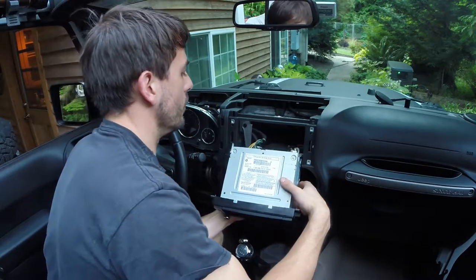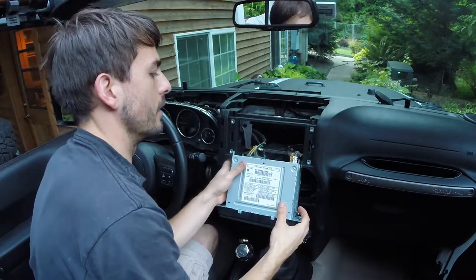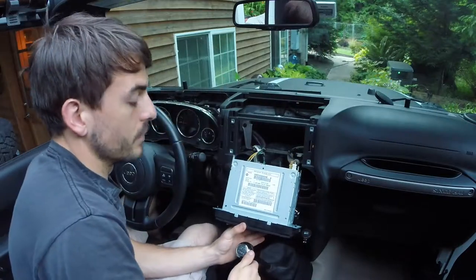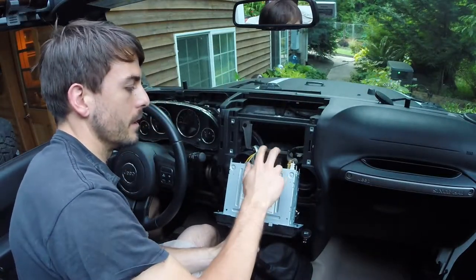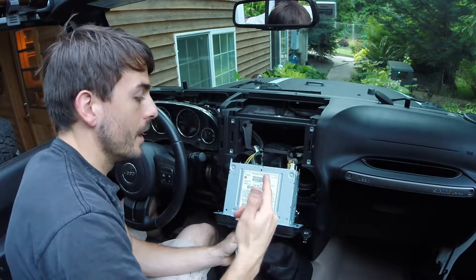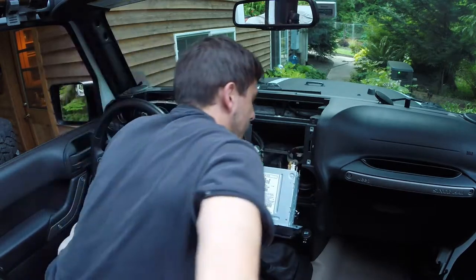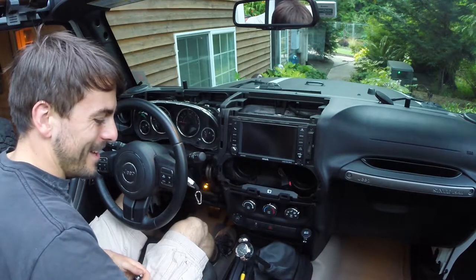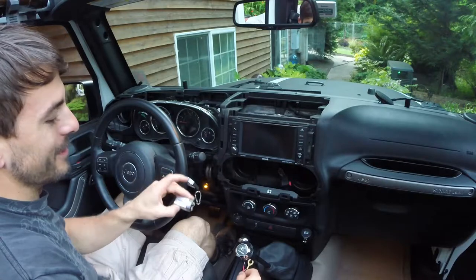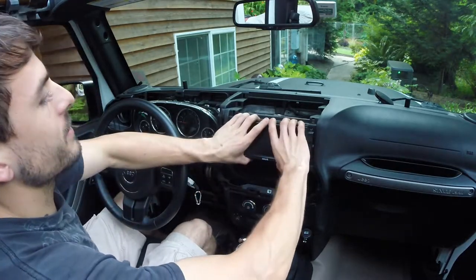I'm able to see the backside and there's a plug right here — I'll put an image in the right hand corner that shows this. The next thing I'm going to do is grab each one of the jumpers, plug in the camera, power on the car, and put it into reverse to check which one I need for the correct pin-out on the back of this unit. One thing I just remembered: I also need a power and a ground to power the camera, so I'm going to use a little nine volt battery to hook it up and see what we get.